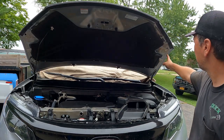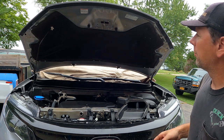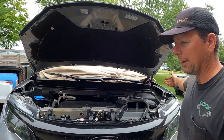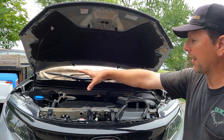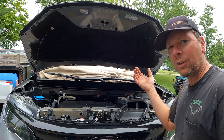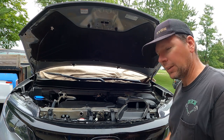As you can see, Surface Shield goes on a lot faster. It's got a little bit of petroleum distillate in it — I don't know if Fluid Film has that or not. I've done the passenger side wheel well with Fluid Film and I'm going to do the driver's side wheel well with Surface Shield. Next year I'm going to be curious to see how the Fluid Film hung on that side versus how the Surface Shield hung on the rest of the vehicle. It's going to be interesting. The Surface Shield really goes on fast — it's more liquid so you can fog it right on.